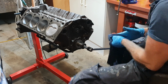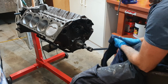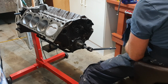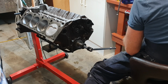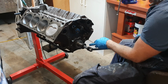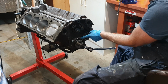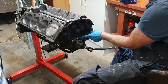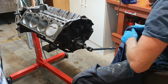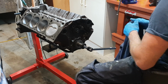You've got to remember too, guys, because you've got the sump down in here, the timing case, you're going to get oil splashed around in here like crazy all the time. So lubrication for the chain isn't an issue, as far as I believe anyway. They used to have another little outlet down here. I've capped that off. I've put a little BSP fitting in there and bunged that off. There was actually a little thing come out and there was another little outlet to lube up the chain. So I got rid of that as well. The idea is we just keep the oil to where we want it.